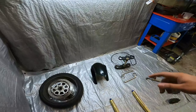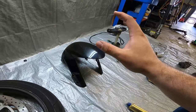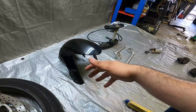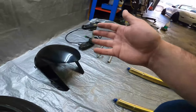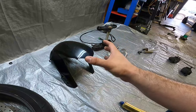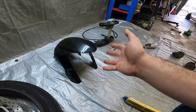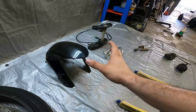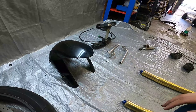After that we have the GSX-R front fender — another optional item, but one I think everyone should keep. The GSX-R front fender flows way better with the GSX-R front end. It bolts directly to the front forks and just looks a lot better than the SV fender when you're doing this swap. The SV fender can be used, however you will need to make a custom set of brackets to adapt it to the forks, and sometimes it looks a little odd in the swap. I suggest just going with the GSX-R front fender — they are relatively affordable.